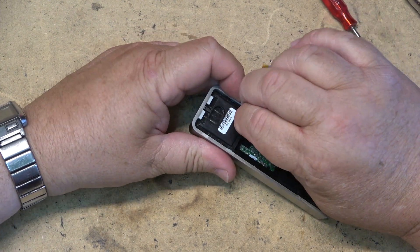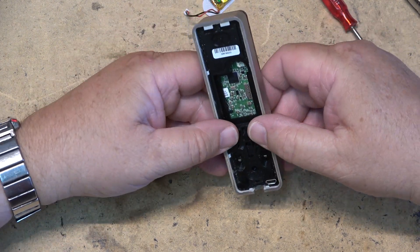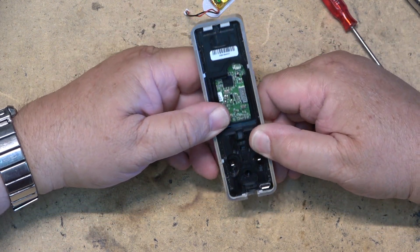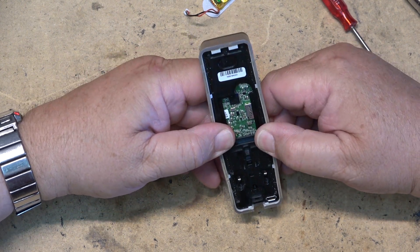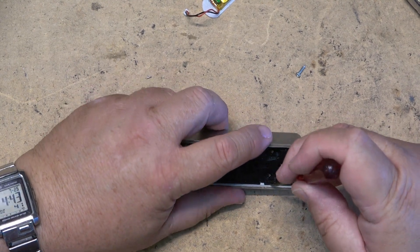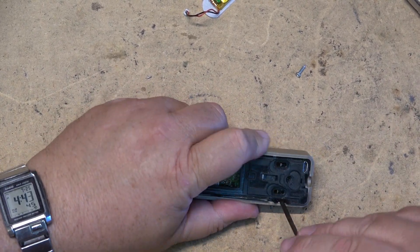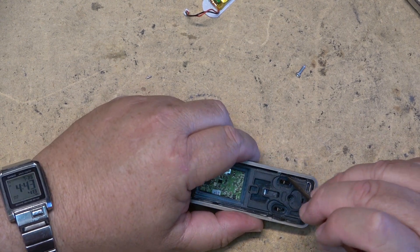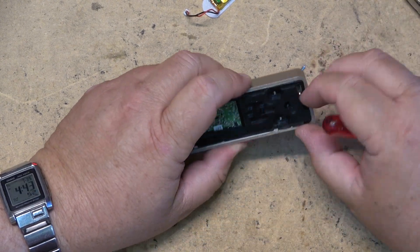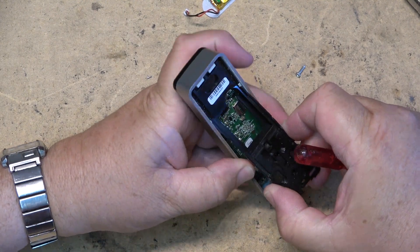I'll unplug the battery — there should be another screw here to open it up. I've never taken one of these apart, so let's just see what's in this thing. Maybe just the one screw and then it should pop apart. The battery is here to power the camera during the momentary time that it's actually ringing the mechanical doorbell, because the power would go off as it closes the contact to ring the bell. One screw — there's a rubber gasket here to keep the weather out, because these are typically sitting at someone's front door exposed to the weather.